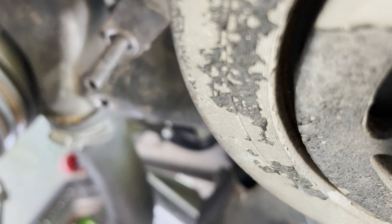And now this fitting, gonna try to get that out. That's gonna be a fucking hoot. The old jam nut trick works again. Alright, so there was nuts behind the compressor bracket, because obviously brake hardware is long missing. And that's one of them for the compressor and power steering. So I just need to take that bolt out, and then we have nice easy access to our pump. Alright, all of our brackets are finally off, and we have nice clean access to our pump. Finally. So going along with everything that comes back from LA Mechanic is full of surprises.